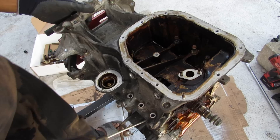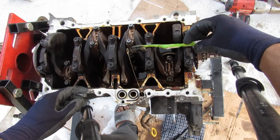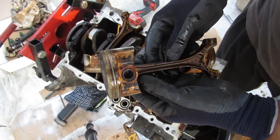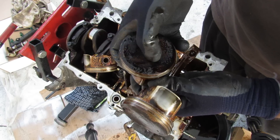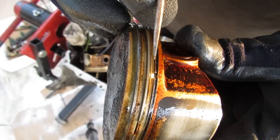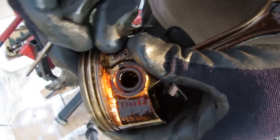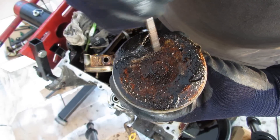There's a hidden bolt inside the lower crankcase section. With it removed you can see the bottom of the crankcase — the piston line is slightly offset from the main bearing line. The rod bearings look absolutely beautiful. The pistons are small for a 1.5L engine with a lot of carbon on top. Movement is fairly free with minimal piston slap, and the connecting rod bearings look okay. The biggest problem is the oil rings — the compression rings look fine, but the oil control rings are completely clogged solid. They should have a springy structure but are packed solid, meaning they can no longer wick oil back down, so oil ends up on the combustion side causing burning and carbon buildup.